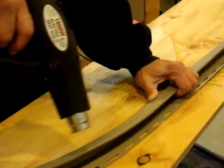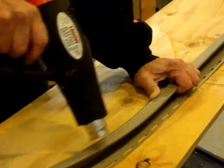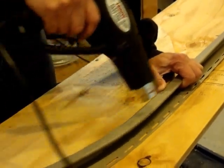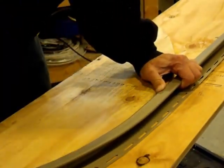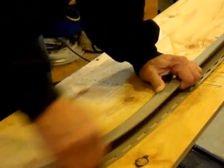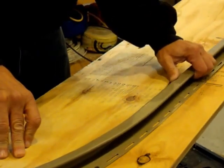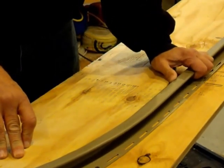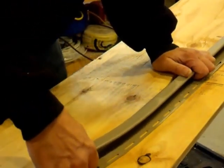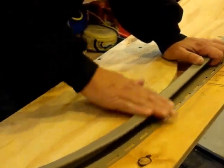You work slowly. I'm twisting — pushing with my thumb, pulling with my fingers. You can see my left hand there and it's coming into place. Then once it's there I'm going to shut the heat gun off and work it down a bit. It springs back some, but that's not the end of the world because I can nail it up. And I'm letting it cool off a bit so that when I start bending the next part, I don't end up overheating and buckling over here.